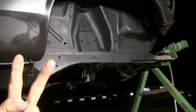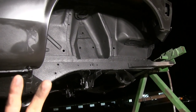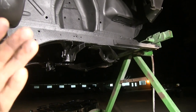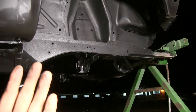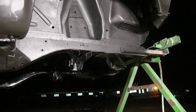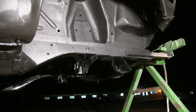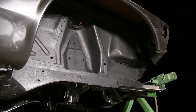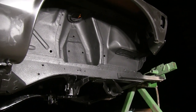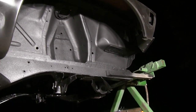I have two coats of rust bullet, then I had two coats of epoxy primer, and since the recoat window of 72 hours was well expired, I had to put another coat of epoxy primer followed by two coats of bed liner. So yeah, you can say that's overkill. I just want to do that job one time.